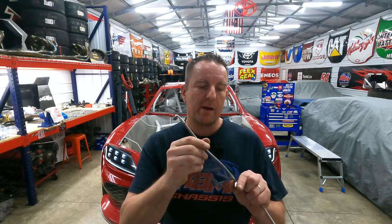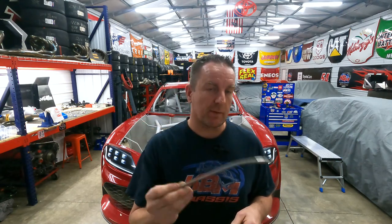Unfortunately, my brake line plan isn't going to work out. I've got plenty of fittings with number 3 90 degree AN fittings on them, and they're perfect, except they're clocked wrong. When they're mounted to the firewall and to the master, it kicks my floating master cylinder to the right and actually binds it up against the pedal mount. So scrap that idea. What I do have plenty of are number 3 AN banjo lines.